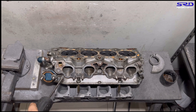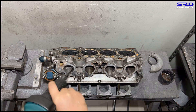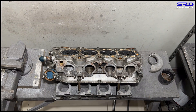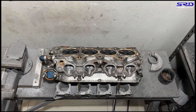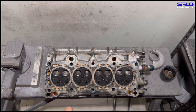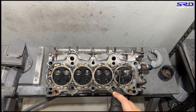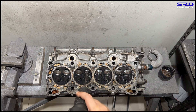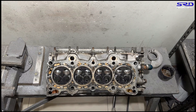Now here we are. We start with the carbide and begin shaping. I like to start on the port side walls to get the contours really good. Some people start with the floor or the roof, but I start from the port side walls all the way to the roof. Now with the bowl — remember the core shift moved to the left — we're going to work on that before we start eliminating the whole thing. We have to gradually start where the core shift is being obstructive to the flow path, because we need to remove that or get that flow good.